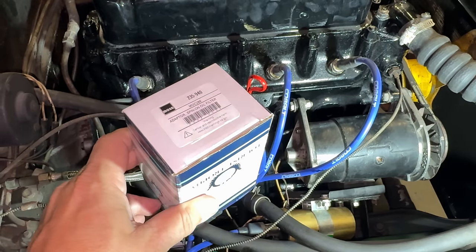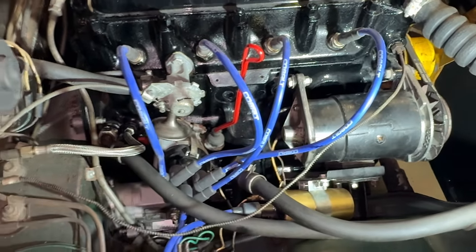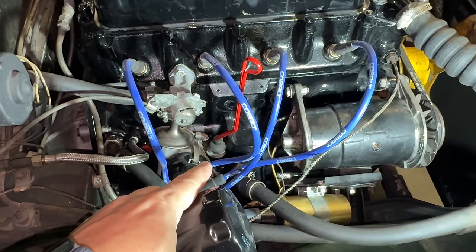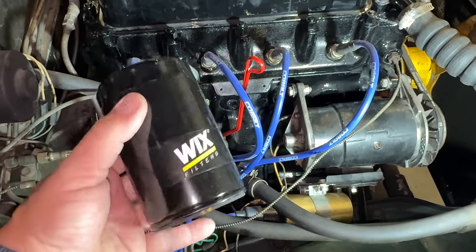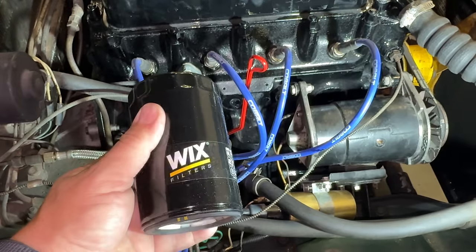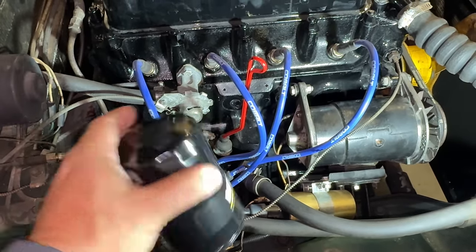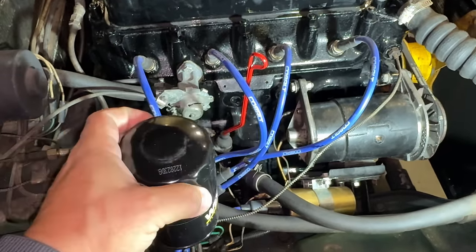That's one of these modern oil filter adapter kits. This allows you to change from the canister type oil filter to using one of these modern spin-on filters. The reason I recommend this is if you're not changing your oil often enough because you either think changing these canister styles is hard or you're scared that it may leak after you mess with it. If you have this type of filter on it, you're probably going to do your oil filter more frequently. Spinning one of these off, throwing it in the trash and screwing a new one on is so much quicker and easier than dealing with these old canister style, and there are a lot fewer places for this to leak. So I do recommend if you are driving your MGB, just go ahead and do this conversion.